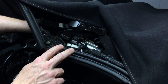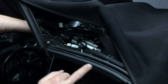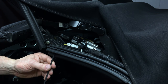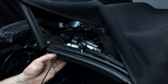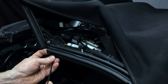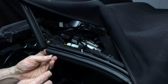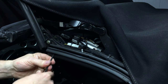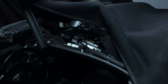Removal is really simple if you know how. You want to take this rubber molding piece off to make the job easier — you can do it with it in place, but you may as well take it off. It has three T25 Torx bolts in here. I've already taken two of them out and now I just need to get my Torx driver back in the right position to take the last bolt out. Three bolts, trim piece out of the way.